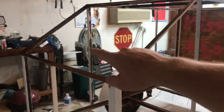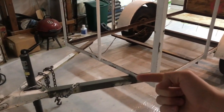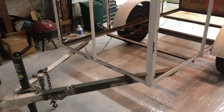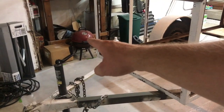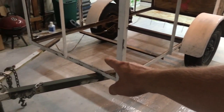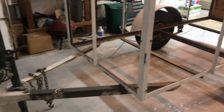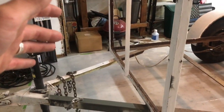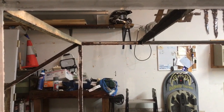Up here on this angled piece, I'm going to be putting a solar panel and possibly a window, if not just the window. And here in the front, I want to be putting a toolbox. I really wanted one of those angled trailer tongue boxes, but I've only got 15 inches from these bolts straight back. From the position of the jack, I've only got 18, but a comfortable 17 inches back. So I'm going to get a square toolbox to put in here, which will house a battery, a charge controller, and possibly a battery solar charger, which will then power the internal lights when it's off the truck. Then I'm going to put a vented or electric fan vent up in here, like an RV, so I can move some air around inside in case I want to use it as a camper.